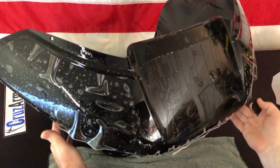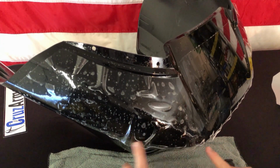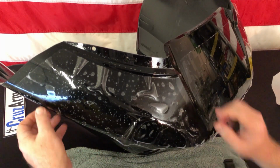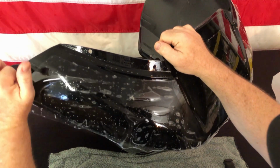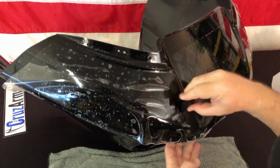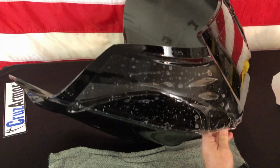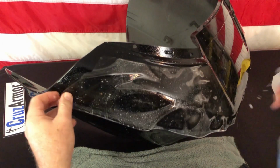Okay. Now for you, it'll be a little easier. What I'm needing to do, we have these fingers. What these are called are fingers, and we need to get rid of those. So the way to do that is by pulling. When we stretch the material, you'll see those disappear, okay? Now on the bike, it's a little easier to do than me here on a tabletop, but I'm gonna do it anyway. So go ahead, make sure everything's wet again underneath.